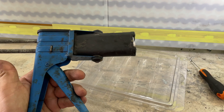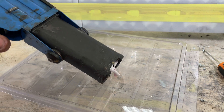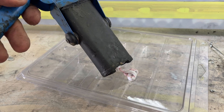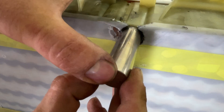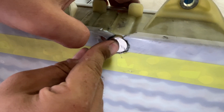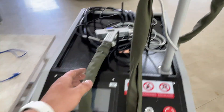Now we will use a special thermally conductive silicone - we will mix it and put it inside. This is especially used in automotive applications - the secret sauce. The glue is inside and now I will push the cell in. It's fully pressed inside. Now I will use my special laser tool to weld the fuse - first the plus, then the negative terminal.